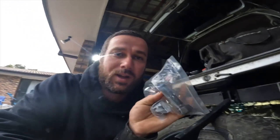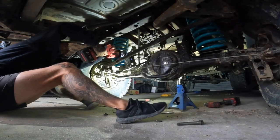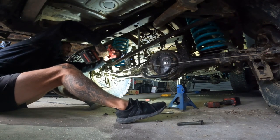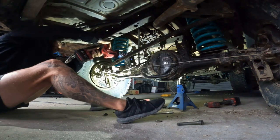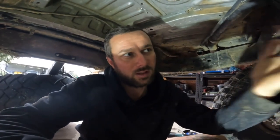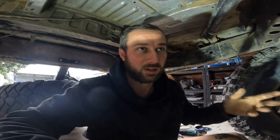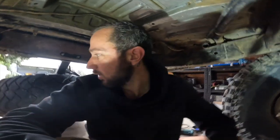I managed to get one out. The other one you can't get out without removing the coil — I believe there's a bracket where the handbrake runs through and you've got to dismantle all of that just to get the bolts out. So they send new bolts — what I'm going to do is just cut the old one off. We've gone and jacked the diff on the pinion to get it parallel with the transfer case. I was just checking to make sure the arms are actually longer — I poked one of the old ones back in and it looks to be about 15mm longer.